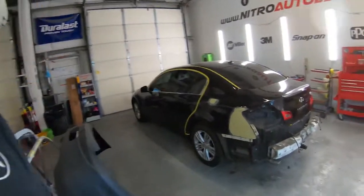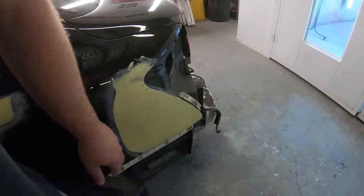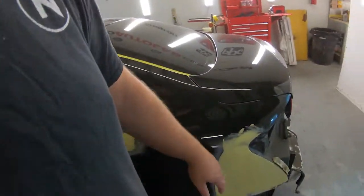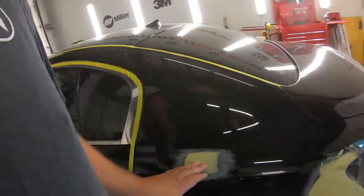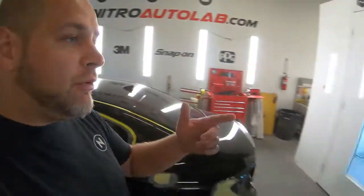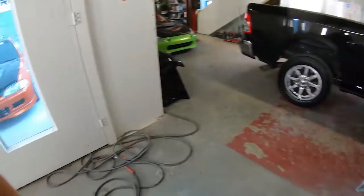We have a quarter panel that was kind of crinkled. We went ahead and pulled the dent yesterday, and there was a little bit of a ding here. Easy color being black, so not too worried about blending. We pulled the dents out, put a first fill in, and we're going to rough this in this morning. We need to get it in high build today so that tomorrow we can move forward with prepping it, getting it in the spray booth, and masking it up for paint. We should have this done by end of the week. The rear bumper also had a hole in it.